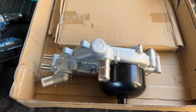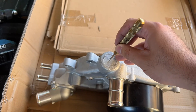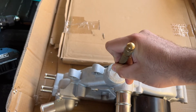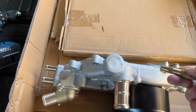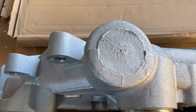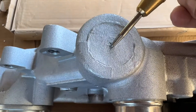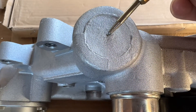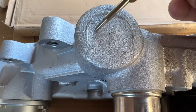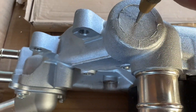In order to do this I have a little spring-loaded punch here. I'm gonna eyeball it right here. As you can see it worked pretty damn good — just a little punch hole here which will allow the drill bit not to wander off anywhere else, it's gonna go straight there. Punch one more time for good measure.